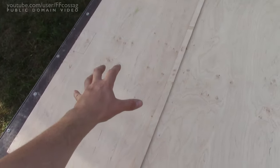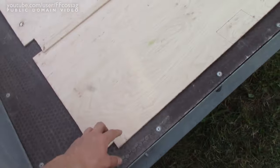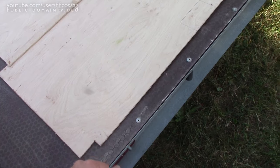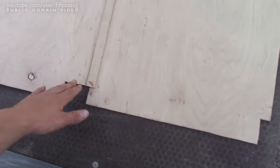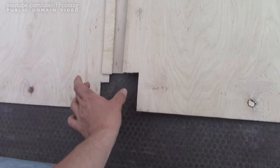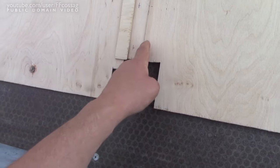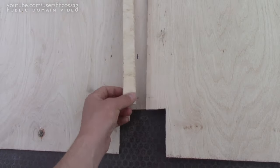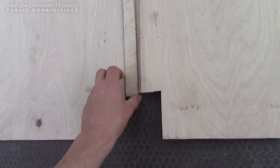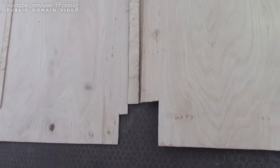So this is the part that goes in the rear of the vehicle. This edge here actually has a bit of a bend to it because the vehicle is about half a centimeter further back there than at the edges, so I had to compensate for that, and it went very well. These little cuts are just to make room for the girders at the top of the vehicle, so the roof panels will not align entirely evenly at the middle girder — the rear one is just going to be sitting right at the edge of it, but that's fine. And I've made these little spacers which I'm just going to attach to the vehicle to make it easier to screw everything in place and ensure everything compresses together nicely so there's no excess bending strain on the board.